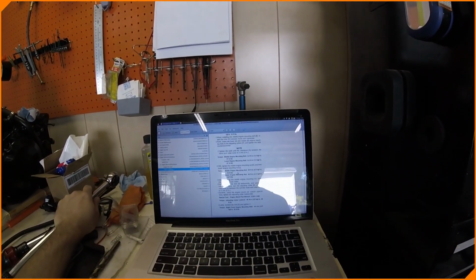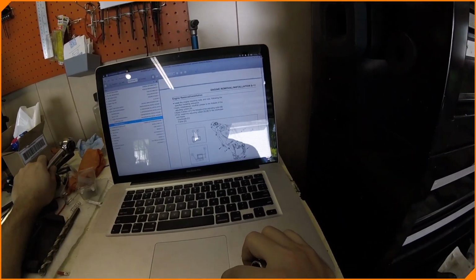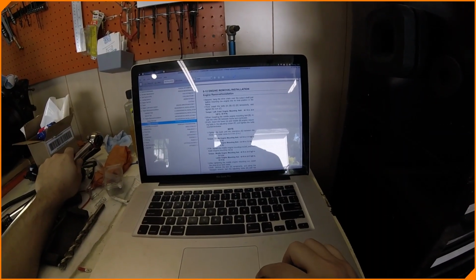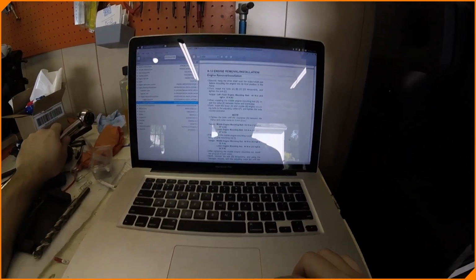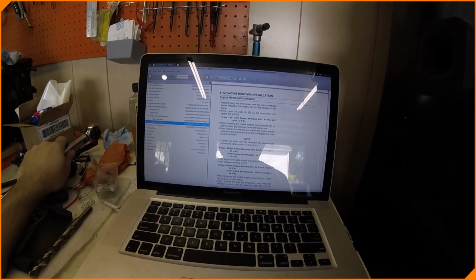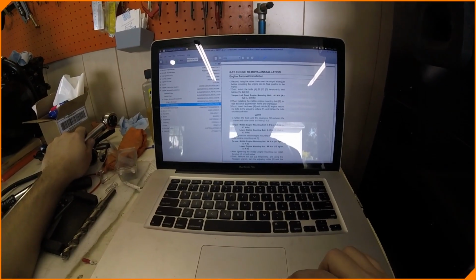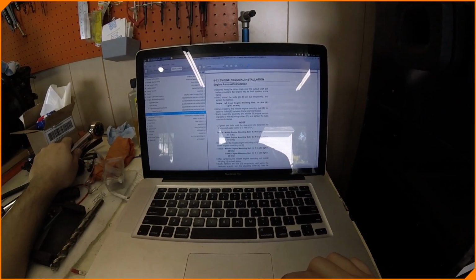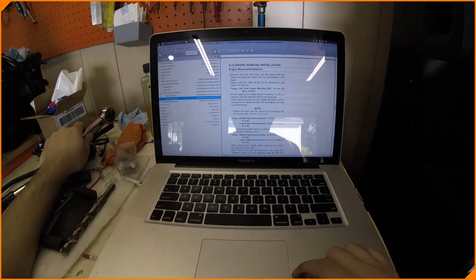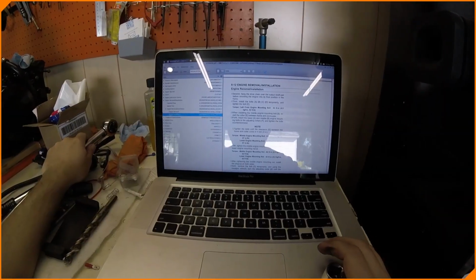Middle engine mounting bolt, which I'm going to call that because it's the middle, that's lower. We're going to take the middle. It's got to be torqued down to, I'm sorry, what? 87 inch-pounds? Huh? And then the nut has to be torqued down to 232. Oh, that's interesting. Okay, that makes sense now.